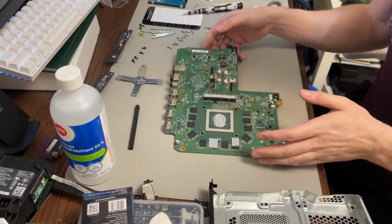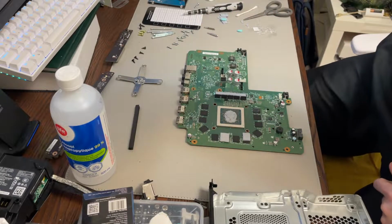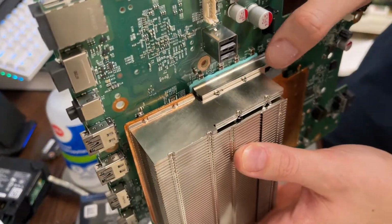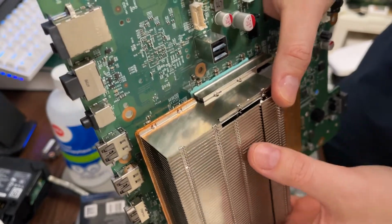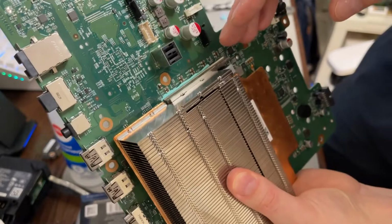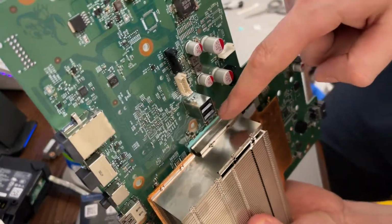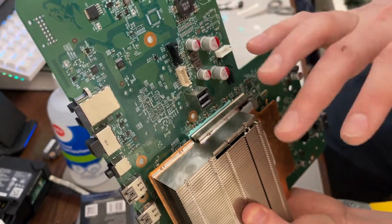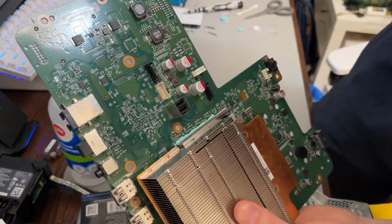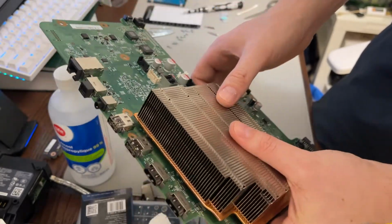I don't know why that didn't have a pad on it in the first place, but there is supposed to be something in there. You can see what I mean here. So, see now, in that little groove right there, we have the little teal bubblegum color that's touching those 4 chips that were there. There was nothing in there when I got the system open. There's supposed to be a strip here for those 4 chips, and there's supposed to be a strip to touch those little 4 there. So that could have been problematic. It could have been a factory issue, and in the long run, it could have caused damage. Someone messed up, put that on, or it came off, and then maybe at some point those chips would overheat and cause damage to the board.